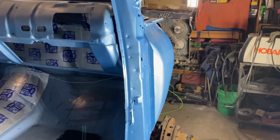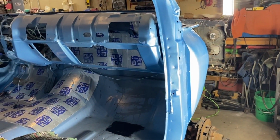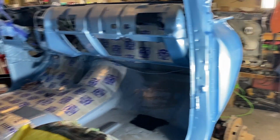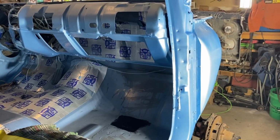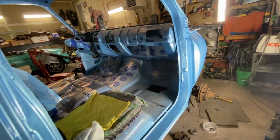So when I bolt the fenders on and the doors on and the box and everything, all of that stuff should line up. If you get this wrong, the cab part, where the alignment holes don't line up and you get your cab on crooked, nothing else is going to line up after the fact. So you really got to make sure you get that part right.